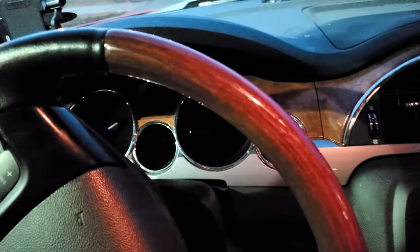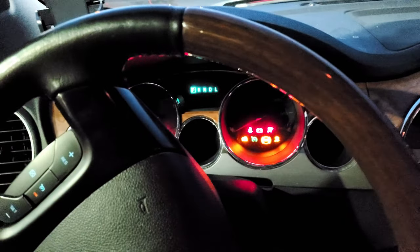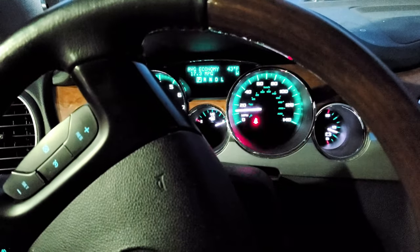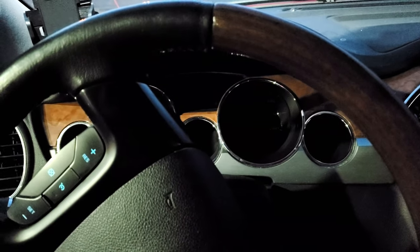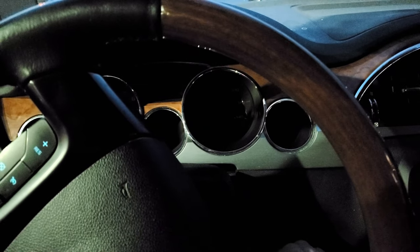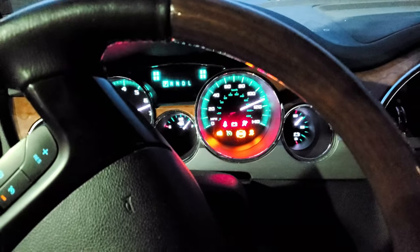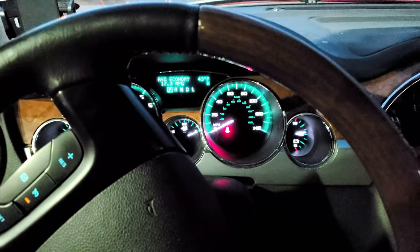I just got fuel in the car. I'm going to try to start it — you hear it continued to crank over but it would not start. Sometimes it will start; you can also assist it by pushing the gas pedal almost all the way down during the start. There it starts right up the second time. It's done this every time now for the last four fuelings.